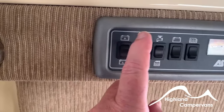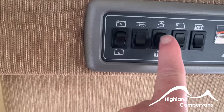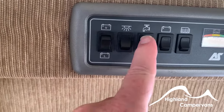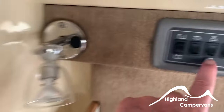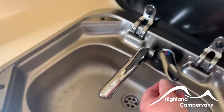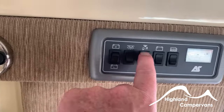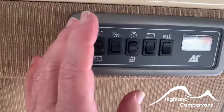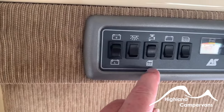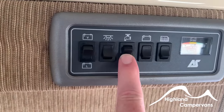Next to that you find the water pump switch. It has a downward and an upward position, similar to the battery selector. You always select the top button to supply power to the water pump, so when you turn the tap on you get water. The middle off position will give you only a dribble of what's left in the pipe with no water being pumped from the reservoir. The bottom position is for a vehicle with a continuous water supply on a fully serviced site — this vehicle does not have that, so that position is redundant.